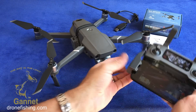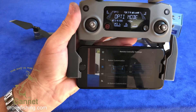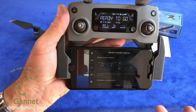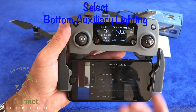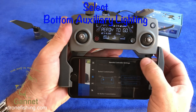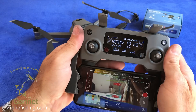To complete the installation you need to go to your drone settings — click your settings button there. Find your remote settings, scroll down and find C1 and C2 programming. Pop that open and find bottom auxiliary lighting, then select that option. We programmed both so we can use either the left or right hand buttons to do the release.